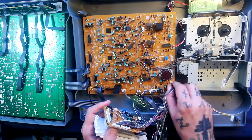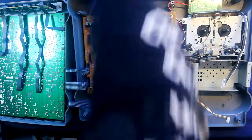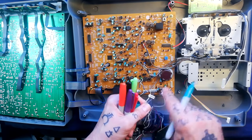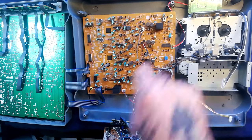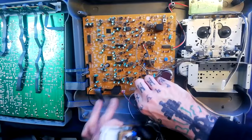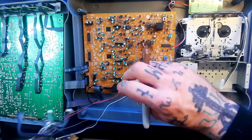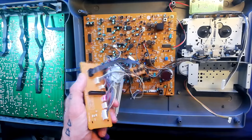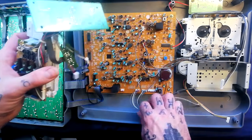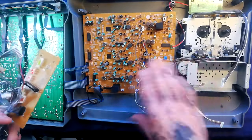I think these connectors all have different numbers of pins. As a precaution, I'm going to take some colored Sharpies and match the color of the header to the connector — this one came from there, so I'll put a mark on both bits of plastic. Perhaps you'll want to take the same precaution if you're disassembling one of these yourself. Sockets number one, five, and six here are soldered in; the connections are at this end, so I'll color them there. That might not have been a very satisfactory step-by-step guide to unplugging those cables, but if you go through this method of color-coding them you'll be able to figure out what happened. Take your own photos as you go along — you'll be fine.